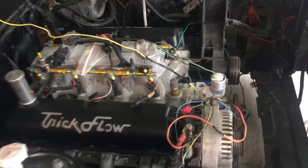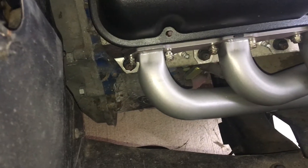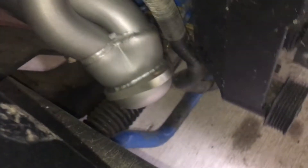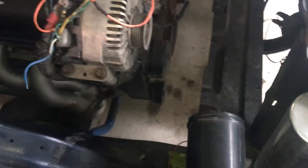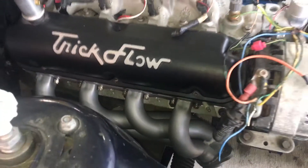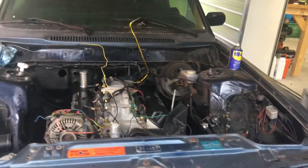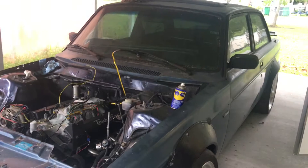After much thought and after seeing a video on YouTube, I realized that if you mount these headers backwards — a shorty header mounted backwards — it dumps in a perfect place to let me mount the turbo up front, which makes life a lot easier. That's where we're at. It's going to be moved inside on the lift pretty soon and we'll see what we do.